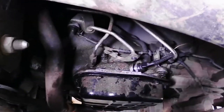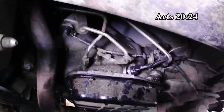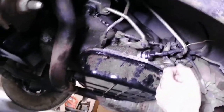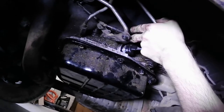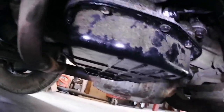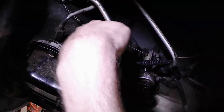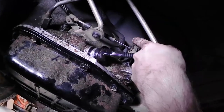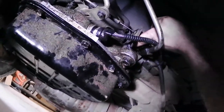Guess which one's broken this time — the rig, or me. I need to replace my TV cable — throttle valve cable, not television — also known as a kickdown cable. The older Dodge stuff had a mechanical setup on the upper lever on these instead of a cable. The spring keeps getting in the way. There's a spring that needs to come undone, and then this is clipped on here and just slips up out of there. I took it off already so I knew somewhat how it comes off.